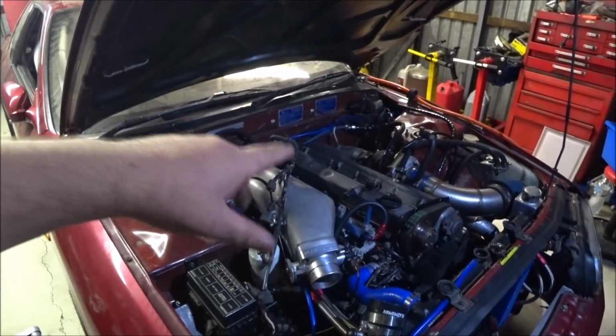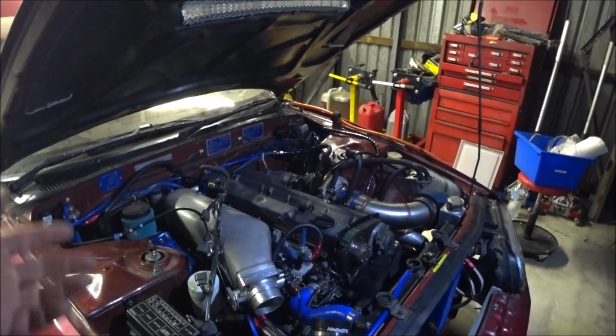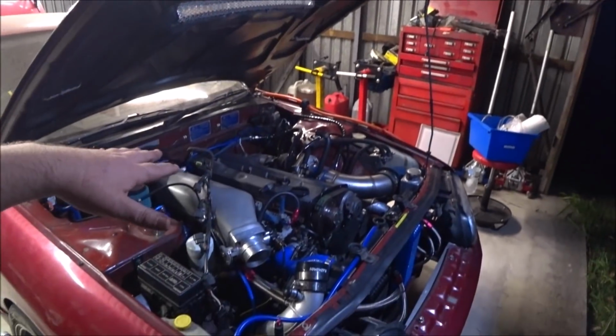So basically take the covers off, pull the cams out, repeat the test, and then if they all seal without the cams in, the valves are being depressed by the hydraulic lifter where they shouldn't be. Bleed them, reassemble the head, repeat the test, and hopefully it goes away. If it doesn't go away at that point, I've got a bigger problem.